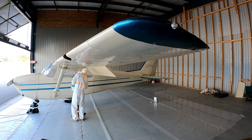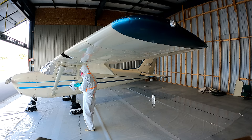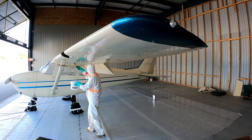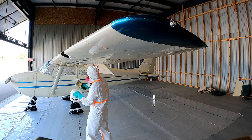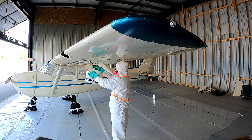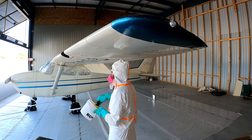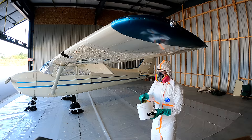About an hour into applying the paint stripper and I've learned a whole bunch already. All those time-lapse videos where they spray it on, walk away for four hours, and come back and hose it off — that's not what's happening here. This particular product dries a lot quicker than they say. They do tell you to wrap it in plastic so the stripper doesn't dry, but doing that solo on a wing has proven too difficult. So I'm dealing with much smaller sections at a time and scraping before it dries.